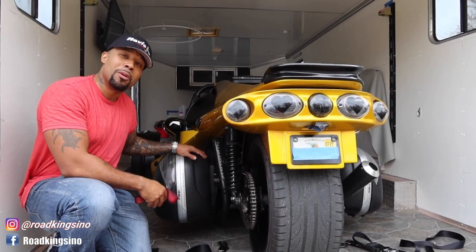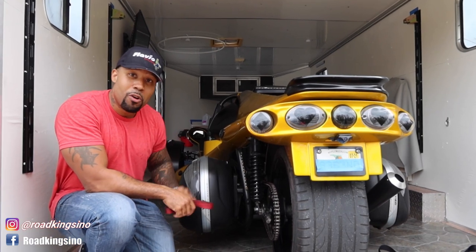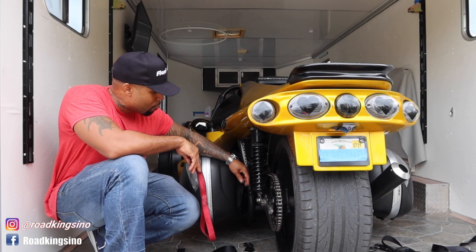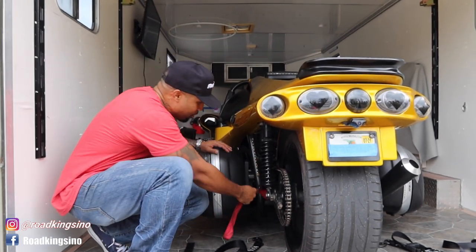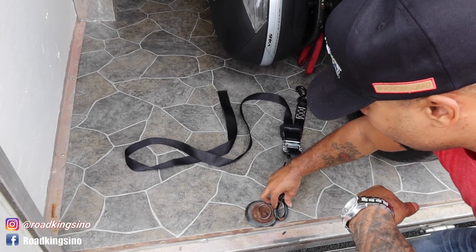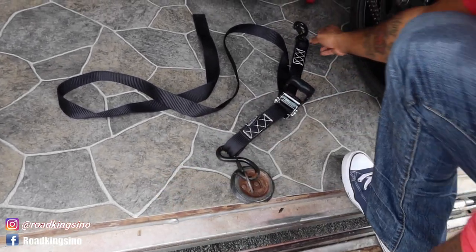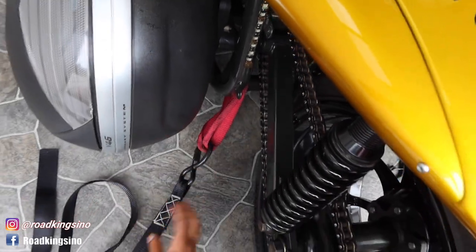Now let's go to the back. Normally you have the brackets where the slip-on exhaust mufflers hang off of, but I removed mine — I have a full exhaust on it now. I've mounted to that before to put a little pressure on the suspension, which is fine. For this video I'm going to be strapping it to the lower part — this crossbar of the frame. I've used this method and haven't had any issues with it. I'll just run the strap through here, loop it through, and that's it. Crank closest to the D-ring on the floor, which is the stationary mounting point. Then I run these two through here and put a little tension on it.